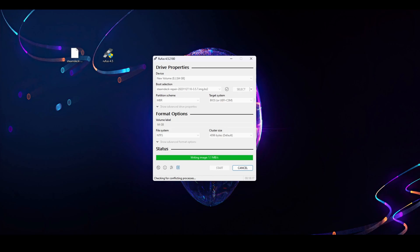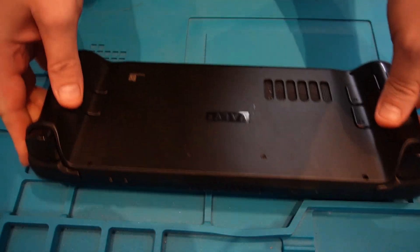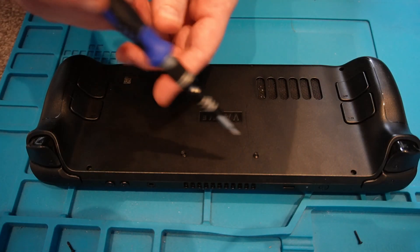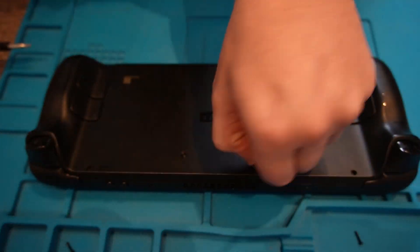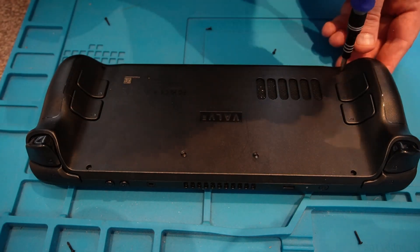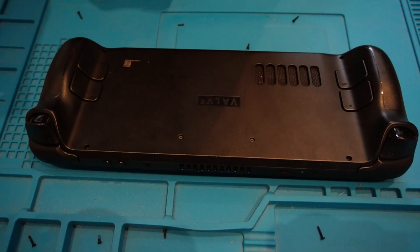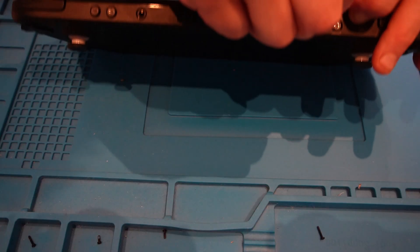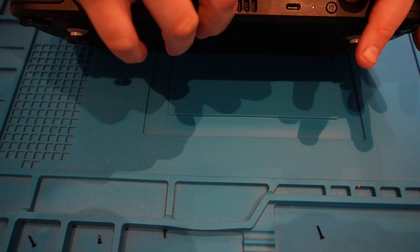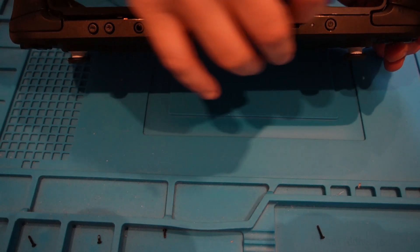Now this process is complete, we'll head off to the workbench and fit the drive. Let's make sure we're powered down and we'll disassemble it. We'll remove the eight screws holding the case together. Now we've removed the screws, we'll take the cover off. What I'm doing is just prising it gently with an opening tool — I wouldn't take a screwdriver or anything to it, otherwise the plastic is quite soft and you'll probably end up damaging it.